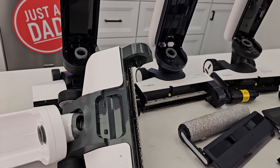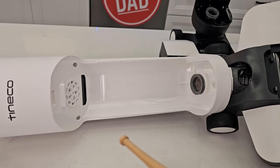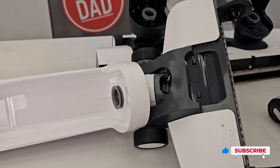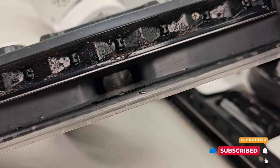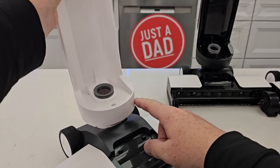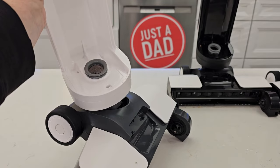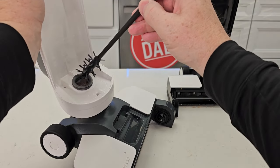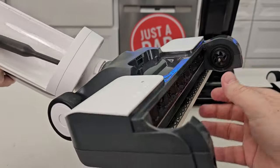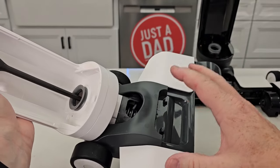What I'm showing you is the same on all of these, but you're going to want to put it on the counter or have somebody hold it. Definitely take your clean water tank out because it could leak. There's a little tube — this tube can get pretty stinky and that's what the brush is for. Sometimes there can be dirt and debris in there and you've got to get this brush and clean that out and flush it out. You've got to be very specific where you put the water; we don't want to get water everywhere on this head. Just put the water down here, take it over to the sink, pour a cup of water down there — you may have to open this up so it comes out the other end. You'll be surprised; there can be a lot of dirt and debris in this tube and it's very worth cleaning.